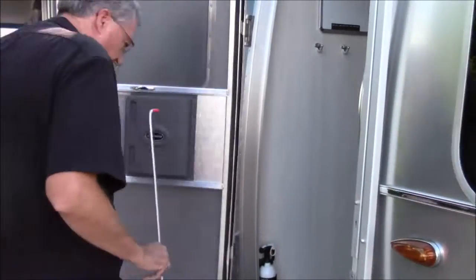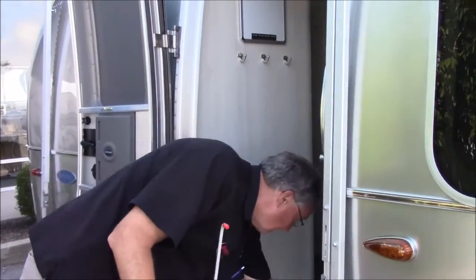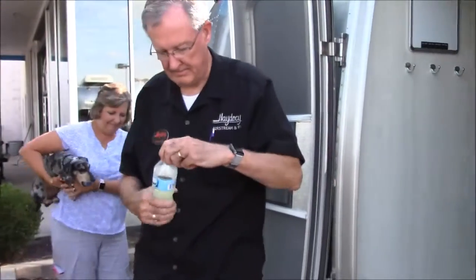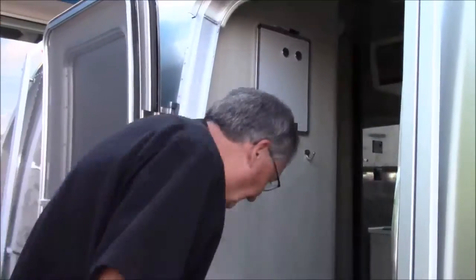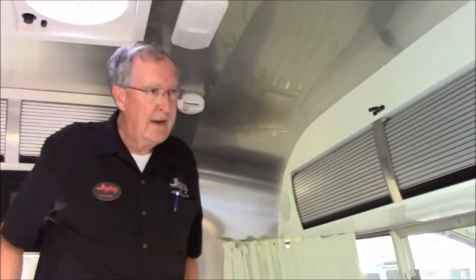I think that's everything outside, so let's take a look inside. Now we're going to start by the door and work our way around again. We've got some switches by the door right here. This is the battery cutoff switch right underneath the dinette here. That cut off switch is exactly the same as if you went outside and took the positive lead off the battery. When you park the unit in storage and it's not plugged in, you want to turn that to off - that disconnects everything so your battery can't discharge. But if you're parked in storage plugged in, leave it on because if it's disconnected it cannot charge. When you're plugged in, it'll keep your battery charged. It'll also keep your battery charged while you're towing - and you need it on while towing because of the breakaway cable.